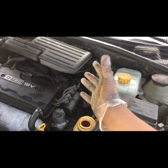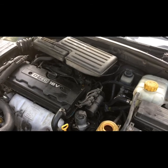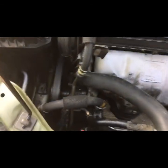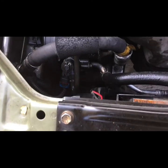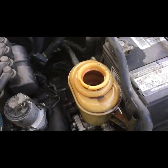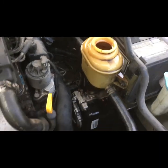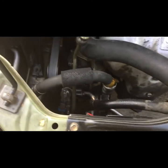So I went ahead and started the car — gloved up. It's a good idea to have gloves on hand so when you get inside people's cars you don't get their interior all dirty. So far so good — the pulley is all nice and straight. I'm going to let it run for a little longer, make sure these lines and these O-rings that I installed are not leaking. We went ahead and topped it off. We're going to mess with the steering wheel a bit to make sure everything is good. You can see right down at the bottom the old leak that was going on. After the bearing shot out it really wasn't doing much pumping — whatever pumping there was came right back out of the reservoir. I'm going to make sure the reservoir is not leaking, but I'm pretty sure that's what was going on. We're going to call this one a job well done.